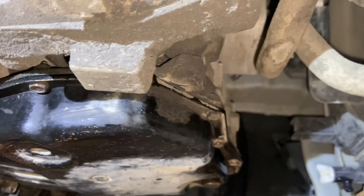From underneath you can see two more bell housing bolts, plus a little bracket held by a 10mm bolt on the left that holds the O2 sensor wiring. At the bottom right you can just barely make out the output speed sensor — getting that one unhooked wasn't shown but it's down there. Moving to the front of the transmission, there's that round gray connector — push in on the tab and rotate it counterclockwise when looking at it.